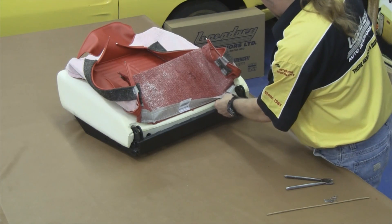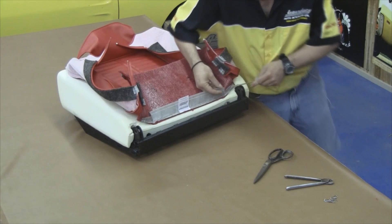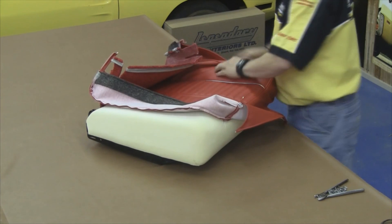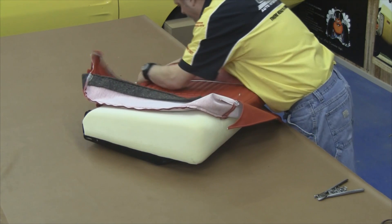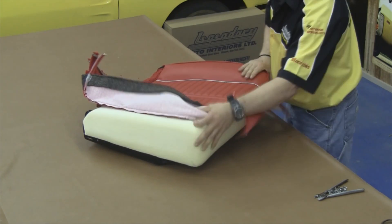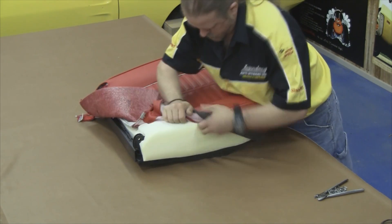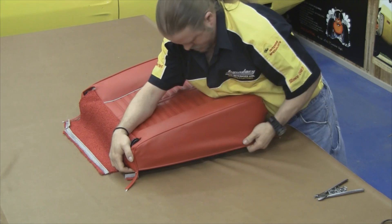Before we wrap our perimeter edges, we want to trim down the length of the rear stretch panel listing pocket so it fits down into the seat frame nicely. Insert your paper-coated listing wire and then we'll install it later in the video. Our next step will be to come over to the front side, wrap the vinyl over the edges of the molded foam. You want to compress the foam up underneath the seat cover and then wrap your perimeter edges over the outside edge. On the back edge, you'll see there's a knockout for the hinge. Do the front area first, compressing the foam and wrapping it over the edge, then gradually work your way towards the back edge, pushing the foam up and setting it over the top of the hinge area.